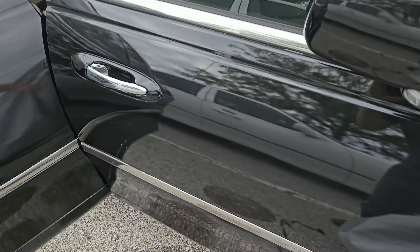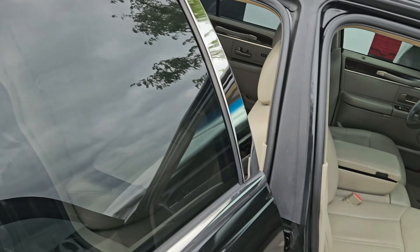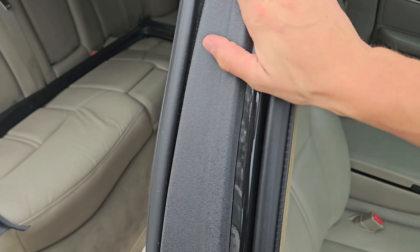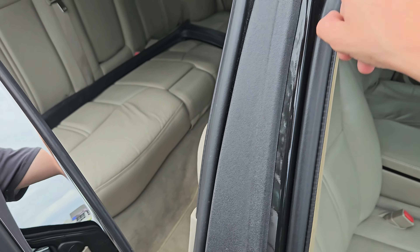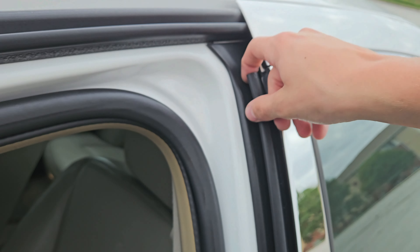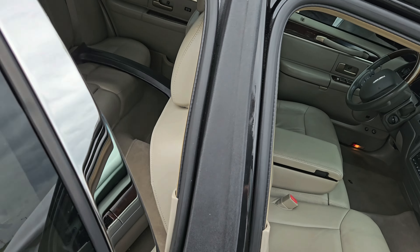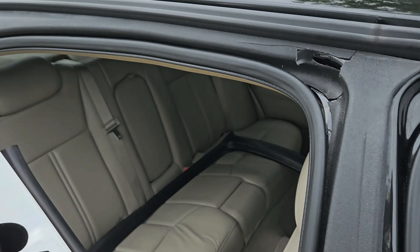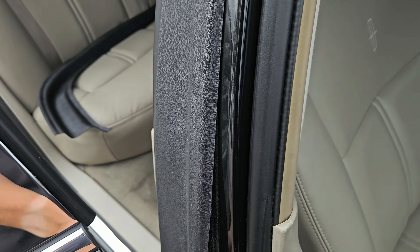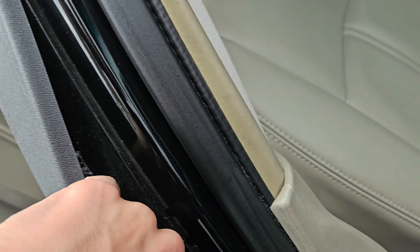Got my car cover here, need to move it slightly out of the way so I can open up the driver's door. That also gives us access to this B-pillar. Now this B-pillar plastic piece is also on the standard ones, but it's more of a soft finish on it. This one is attached to the whole thing — so let's just tear this right off. Not much to it, just double-sided tape.